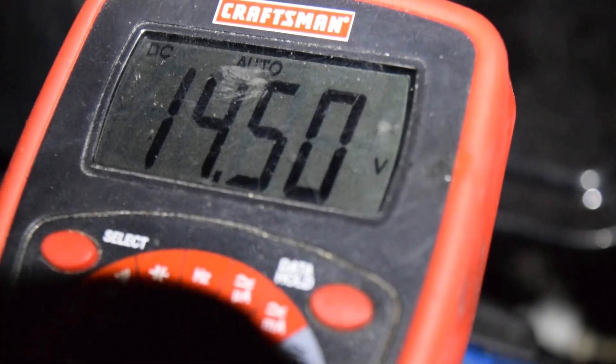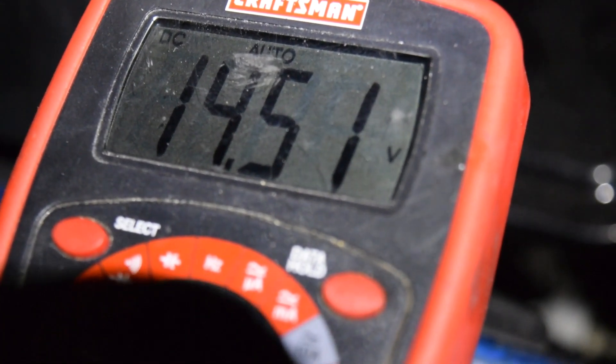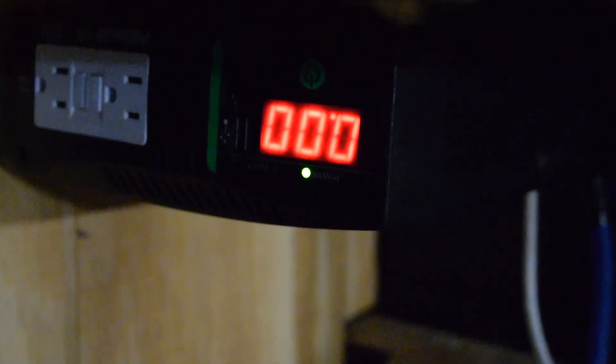It's now installed — you can see the battery is clearly charging, actually charging pretty high. Let's go check on the auxiliary battery: I just turned the power inverter on and it said 12.5 volts — now it's at 14.6 volts. It works! I'm going to check whether 14.6 is too high for the alternator.